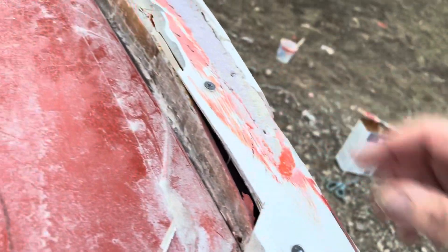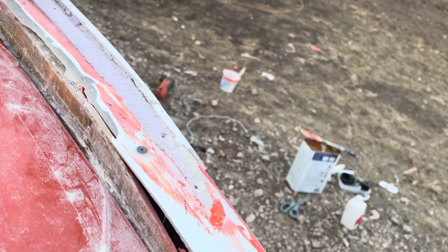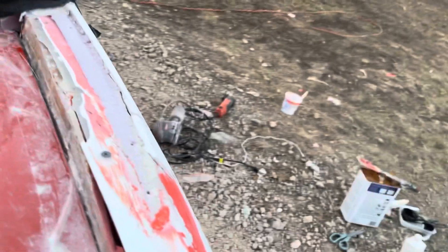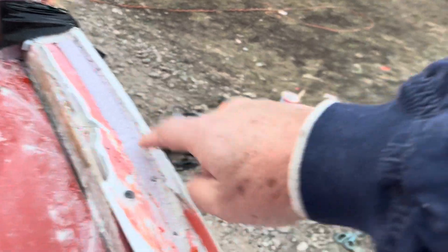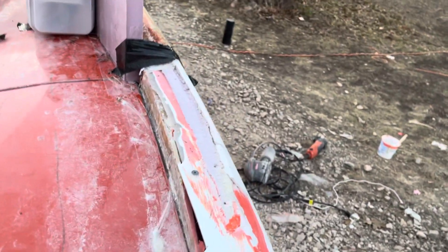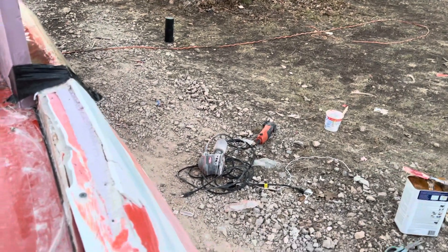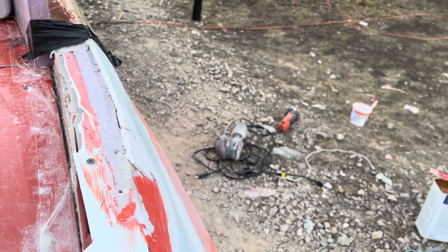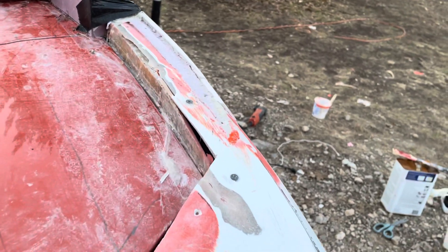Ideally the inside edge will be absolutely smooth and flat and won't require any body work. Someone suggested using just body filler, but the problem is this whole thing has to come off and I really need to reinforce it from the back side to make it strong, get rid of all the foam and plaster, and make it as lightweight as possible. I'll then go in the back and add a layer of roving to stiffen everything up.